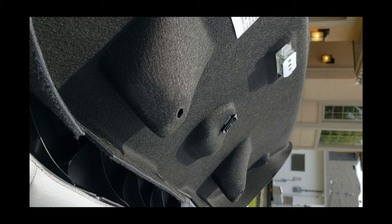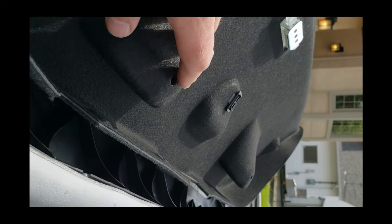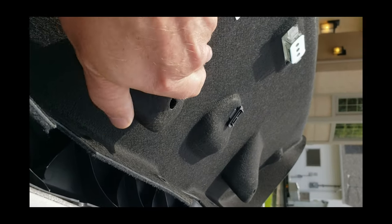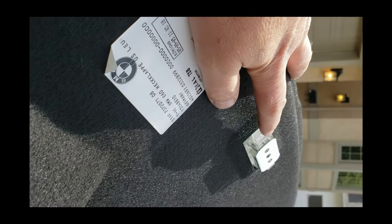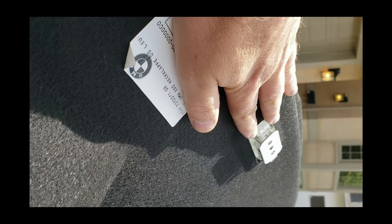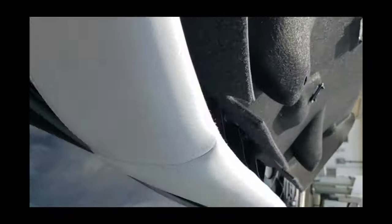Right, so it turns out it's actually 14 of those plastic rivets, not 12. There's two more here and on the other side in these pockets that I didn't see before. And then you have to remember to unclip the illumination lamp harness here before you let this drop too far. Other than that, it came out pretty easily.